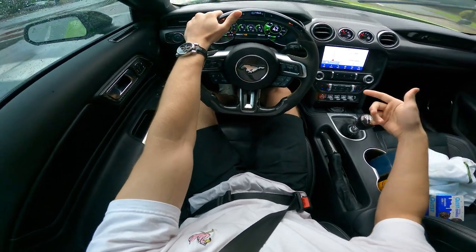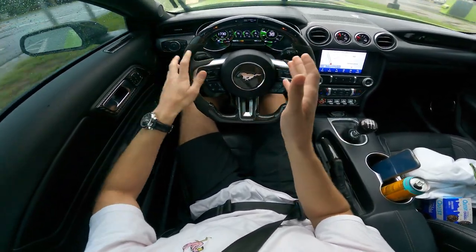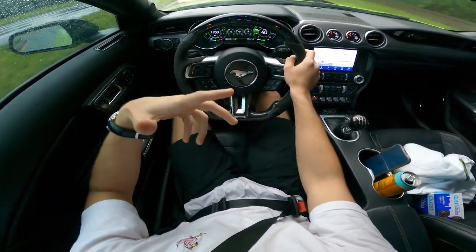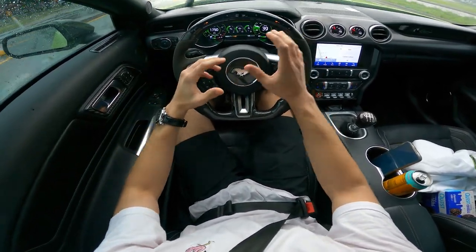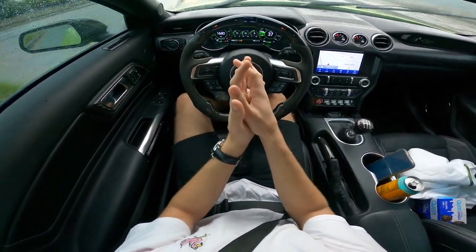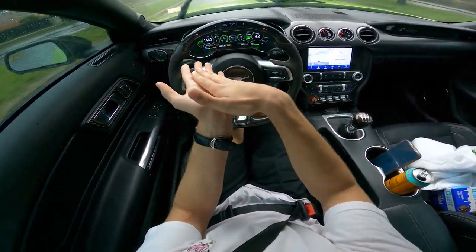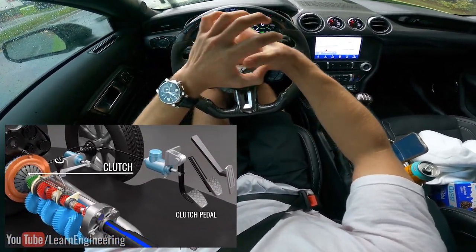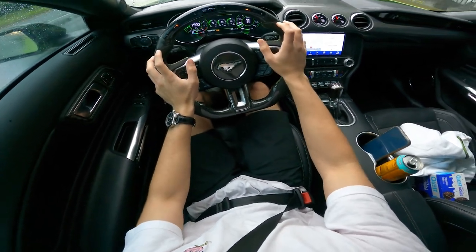What they're doing is going into a lower gear and letting go of the clutch very slowly. I'm telling you guys, if you have a car that's making power and you're doing that while roll racing, you're going to cook that clutch in no time. You should not be slipping the clutch like that unless you're launching the car, and even that is extremely abusive. If you repetitively downshift and just let the clutch out slowly, you're going to decrease its lifespan. The way a clutch works is it's two meshing plates — this car has a twin disc clutch. Every time you push the clutch down you're disengaging those plates, and if you release it very slowly, they're rubbing together at high RPM and cooking the surface.